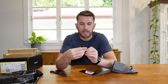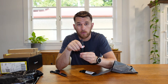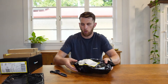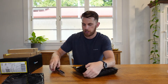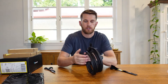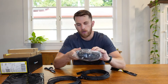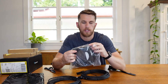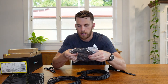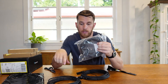So this is a 10 amp fuse that will come off of the solar panels themselves before they enter into the van. And it feels like some more wiring here, nothing too exciting just yet. And this is just more wiring — oh no, this is to connect to the batteries because it does have the battery mains here. So that must run from the MPPT charger straight to the battery.